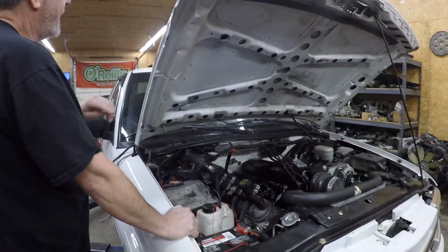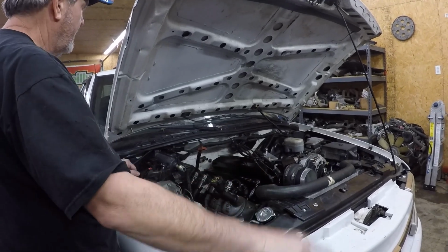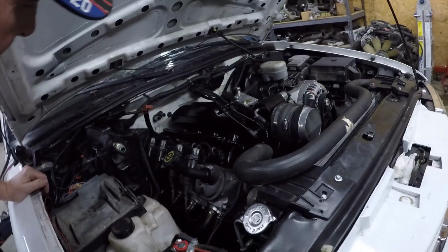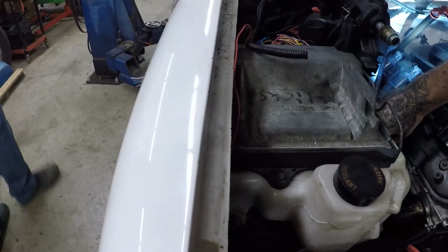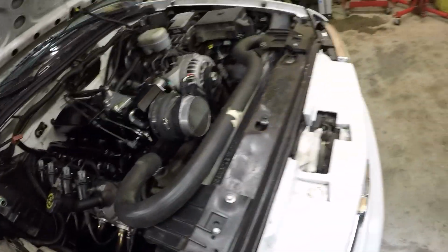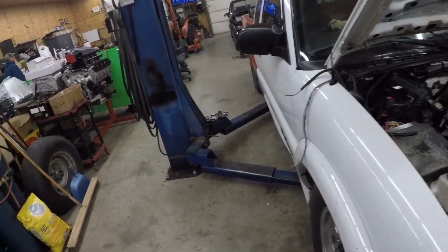Every time you try to give it gas, it's like it runs out of gas and then does that. It may be out of gas. That's what I'm wondering. That's what it's just got smoking. I think it's from grease on there. Actually, I think it's one of the plug wires that's sitting on the header. Oh, that ain't good. It's got a sock that's supposed to go on. It needs them, the factory little things that go right.